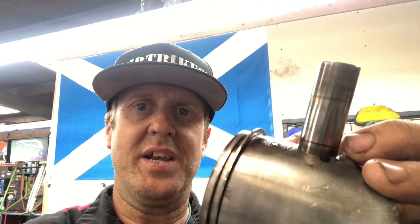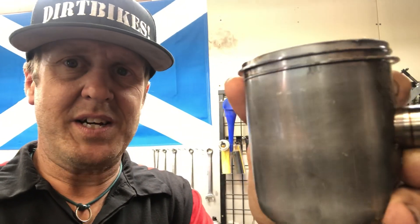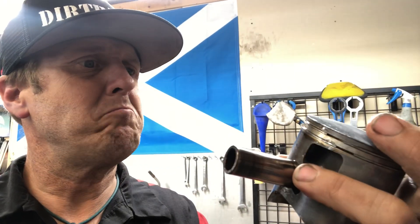Here's what the piston looks like. The top is definitely a little rich. I don't mind that at all — rich is good because it doesn't blow things up. You can see the only thing that's a little bit concerning, and it's probably the length of time it was in there — you can see up here it kind of looks like it got hot maybe. But where the bearing rides, where it needs to be good, it looks nice and shiny and good. There's some funky little mark right up there — I'm not sure exactly what that is. Maybe some dirt got in there, or maybe it got extra hot one time and touched the cylinder.